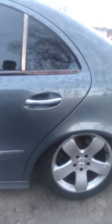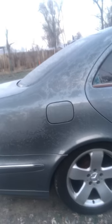And this is where it was. That side. I'm going to check the other side because it should be the same for both rears. Oh yeah, we're on the frame. The front is outstanding. This side's higher up than normal. You can hear that pump going off. Hear that squeak right here? Squeak, squeak, squeak. That's a bad belt. Close the hood. Make sure all my tools are out of the way first.